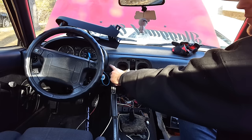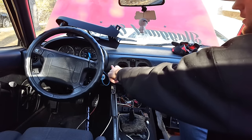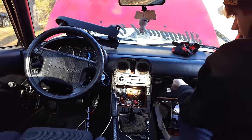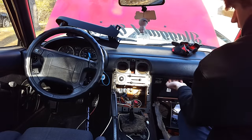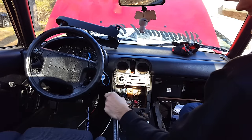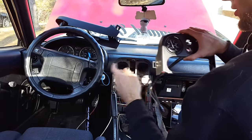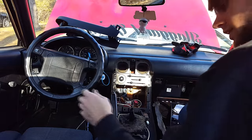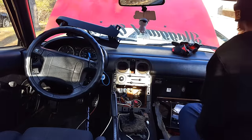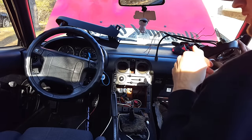On this side I felt metal, so I'm just gonna use some self-tappers and they'll hold through the metal, drilling right through the little bit of foam on the dash. On the other side there's nothing but foam and plastic, so I got a little piece of wood I can fish up behind there through the glove box hole — the screw goes into that and acts as a really big nut. When I'm done, I'll make little plastic caps to hide the screws, and I'll probably do something with the other long L bracket up here for extra support.